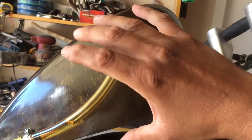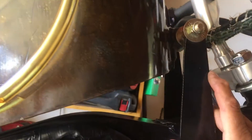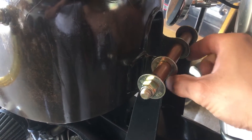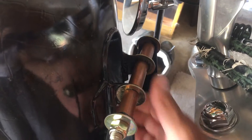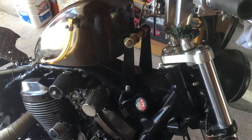The nice thing about the design is you can always move the tank forward or a little bit back depending on how far forward you like the tank. Up here, the tank is made for a saddle — you can see the two little saddle points right here. We took what I think is a 3/8 dowel, put it through here, and took some copper tubing and just laid it over the top of the dowel as it was threaded through, with lock washers and nylon nuts.